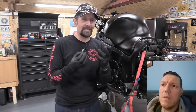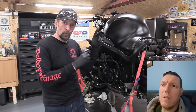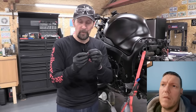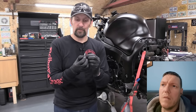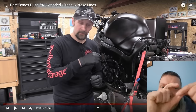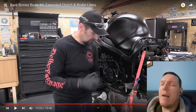There's a simple way around it. It also helps when you're cutting those last little strings of bubbles when you're bleeding in the other direction, doing normal brake bleeding, and you get those constant bubbles that won't go away. You're drawing the air down the side with the thread. This is a problem. Bleed valves really aren't that well sealed. The minute you open them, they draw air in, or if you're forcing the fluid in, they'll squirt it out the sides. That's the whole point, is you force it in. The air can't get in if fluid has been forced out. It's how they work.